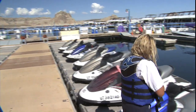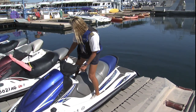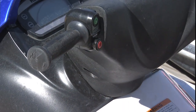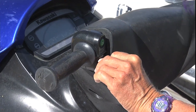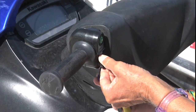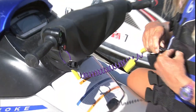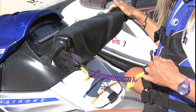This is a Kawasaki. When you rent a jet ski, you'll find it here. There is a lanyard on a jet ski. You have a green start button and a red stop button. The stop button has a safety feature built in. In case you fall off of the jet ski, it will shut the engine off. So this is called a lanyard. The stop button pulls out and this little key goes up behind the stop button, and that leaves it out so you can then start the jet ski. You hook the other end of the lanyard onto your life jacket so that if you do fall off the jet ski when it's underway, it will kill the engine and the jet ski will stop.